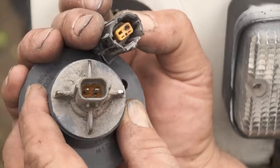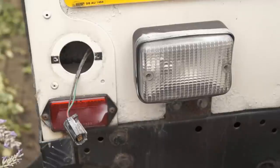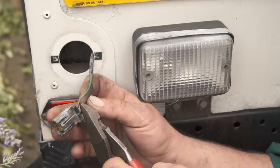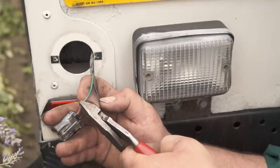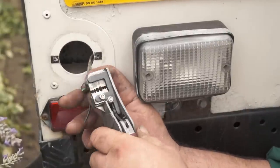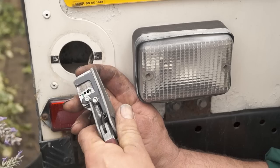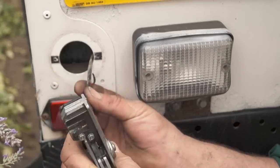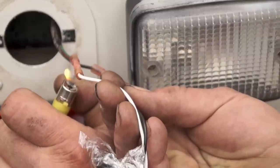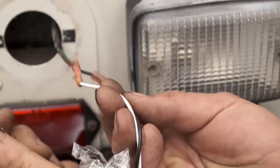The only problem you may possibly find is connectors that are corroded and not usable. Just take note of these wires — we have green with a red tracer and black for earth. That will give you an indication of the circuit for the lighting, and the tracer indicates that it is a near side indicator bulb. So I'm going to cut these, strip these, and put heat shrink connectors in for the moment until we can get some proper connectors, leaving plenty of wire so we can repair it again as required. Heat shrinks are a good option for repairing wires — they are sealed and will stop water ingress for a longer period than the blue terminals will.